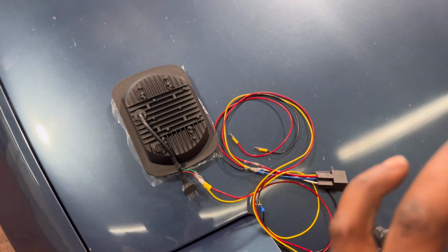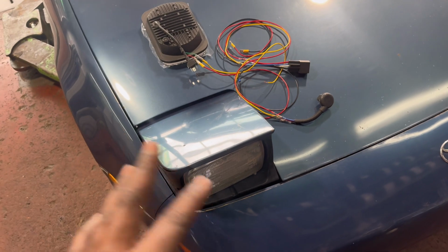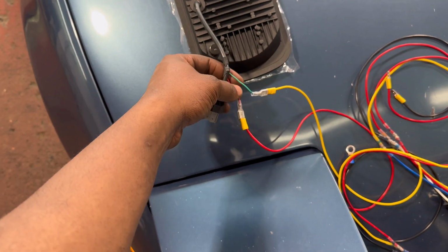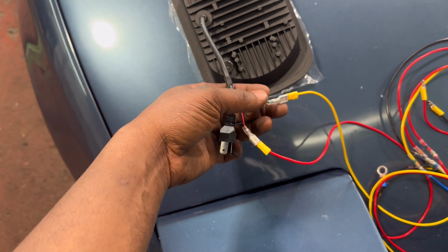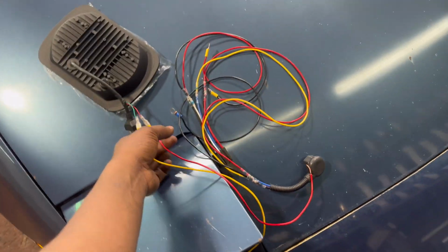Now as for the wiring, I'll leave a link in the description that talks about how to set it up a lot better than I'm about to. For that video, he did it on a Mark 1 MR2. This is the generation after, but I'm pretty sure in terms of the headlight and the wiring and everything, it's all the same. So I'll leave a video in the description so you guys could watch that if you need something more in depth. But to try and go over it briefly, here, this red and green wire that branches off from the main harness, this is the DRL wire, this is the turn signal wire, and I added just some connectors there, and they're going to be spliced directly into the turn signal bulb, because the turn signal on these acts as kind of like a fog light or a DRL, and then it has a turn signal function, so I'm going to be tapping into that.